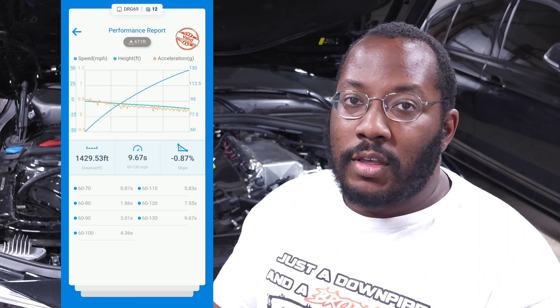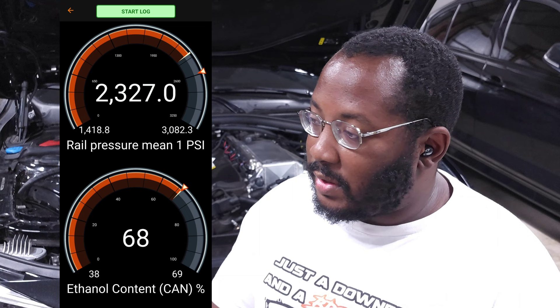After that we went back to the fuel pump and filled it up with a little bit of ethanol to target E40. I still didn't quite hit E40 — it landed at E39. It still took off a significant amount of time; I ended up running a 9.6 second 60-to-130, which is over a second — almost two seconds — faster than the 93 octane time. Then we filled up the rest with E85 and it ended up hitting around E68 or E69.